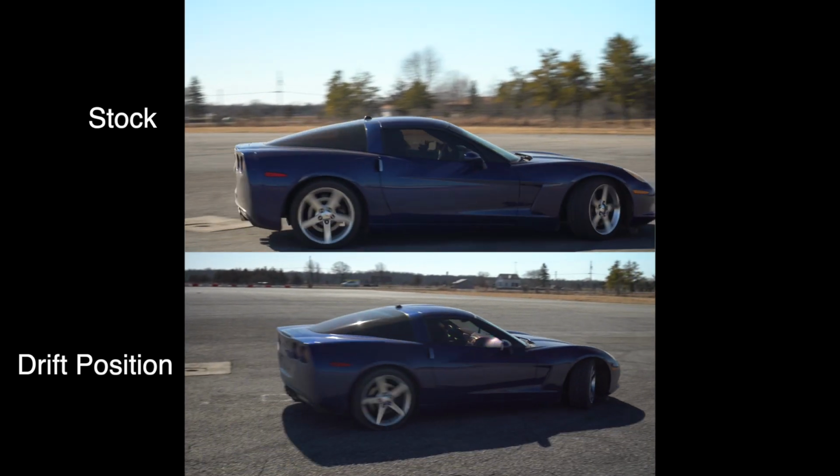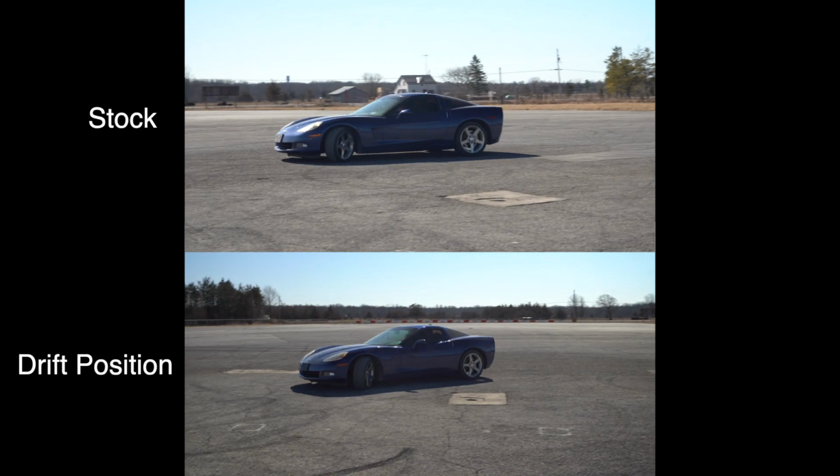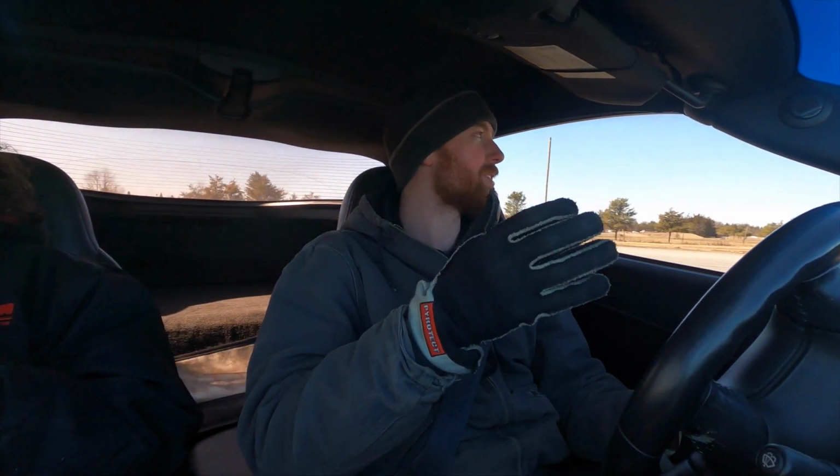but I think that this tie rod position is actually the perfect spot, to the point where the wheels just start to rub. So if you could put on a slip-on spacer, you'd be golden with this setup and factory wheels and stuff. Now, if you were able to lengthen the arms or get aftermarket arms, you'd have nothing but clearance with this mini kit.